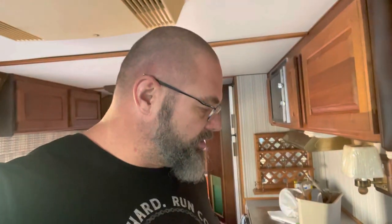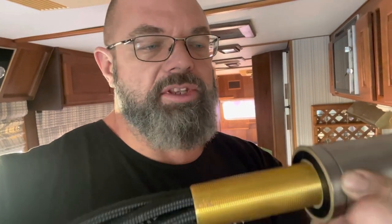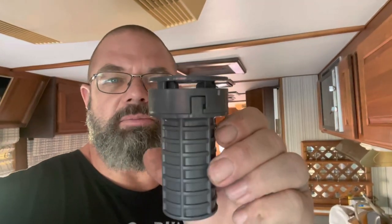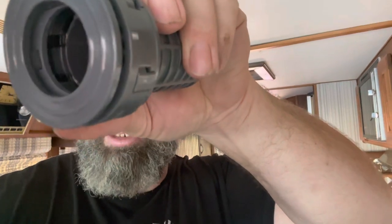And a slightly interesting note with this faucet: normally where this part goes through the counter, there's going to be a large nut and usually a washer that you would tighten up to clamp it to the countertop. This one, however, comes with this weird assembly. When this presses down like that, it actually squeezes the threaded part on the inside so that it grabs the thread. So you can slide it right up, put pressure on it, twist it really quick and tighten it. No tools. It's got a grip. Never seen that before.